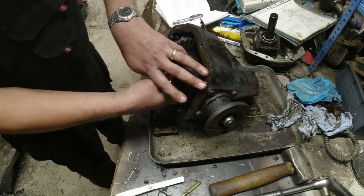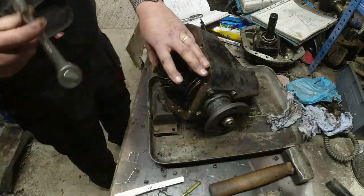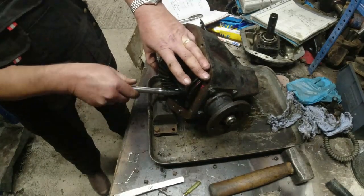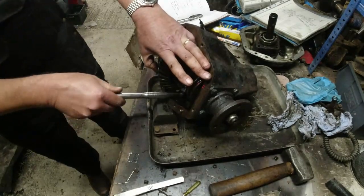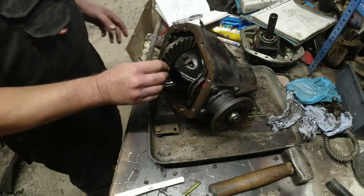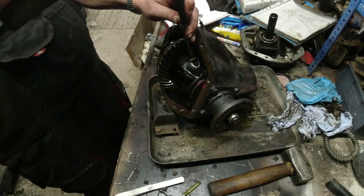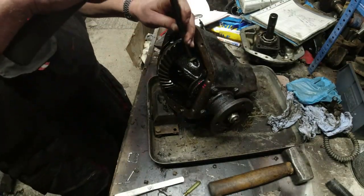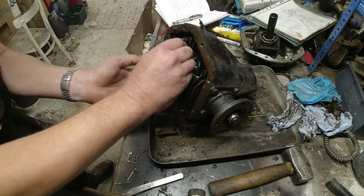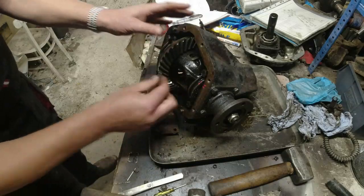And hold with finger. Push pin back up. Might need a bit of leverage on this. Goes. It's up there. Shim is in. Now I tap it right the way through. Take the other shim out, which I should be able to do any second. Oh, pins drop right down. I don't want to lose the sun gear as well, you see. Sorry, planet gear. There's that washer.